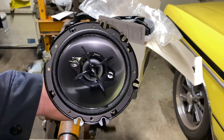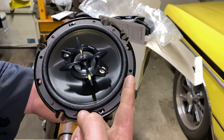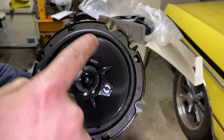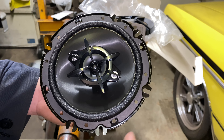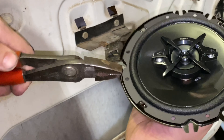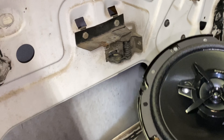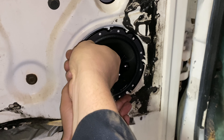There are only two modifications needed to make these speakers work in the doors without modifying the doors. These tabs stick out and you've got to bend them straight up and down — just bend them up a little bit all the way around. Then these two holes here will work in the door, but you have to drill out a couple other holes down here — not a big deal, simple, that's an eighth inch drill bit. I just grab my pair of pliers and bend them straight up like that. You want them like that all the way around.